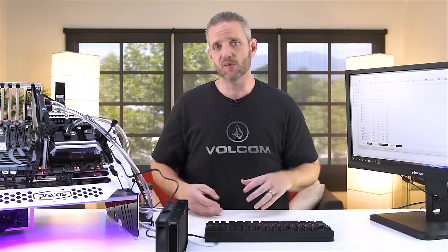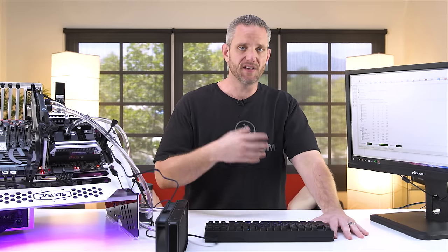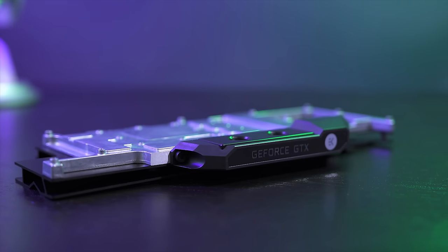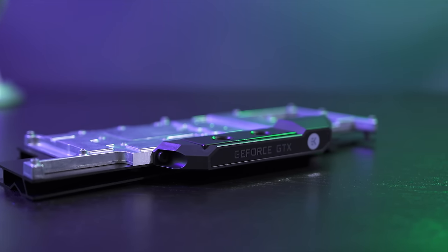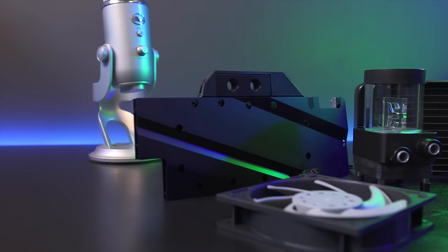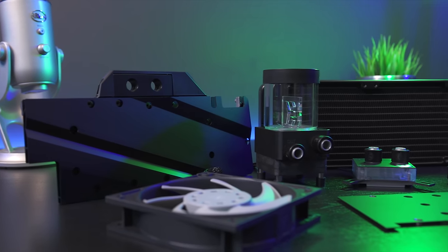Well, here's the thing. Aluminum itself is not the problem. The problem is when you mix aluminum with other metals, it can accelerate the process of galvanic corrosion. Your cars, most of them today, modern engines have aluminum heads, aluminum blocks, brass radiators, and they're mixed metals. So you have to have some sort of corrosion inhibitor in there to keep growth as well as corrosion from happening. Now, galvanic corrosion is something that can happen even without fluid.